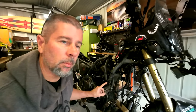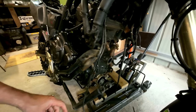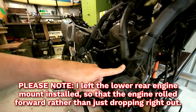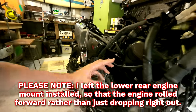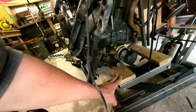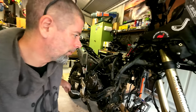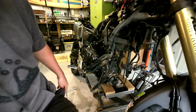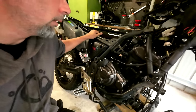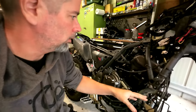I'm already dubious about being able to put this all back together — so many wires and clips and God knows what. The engine mounts here are out, but there are obviously others that need to come out before the engine rolls forward. I've got the bottom of the sump resting on the jack. Ideally a paddock stand would be a good thing, but I don't have one. I'll just need to figure out what else needs to be undone before I can drop it down a bit more.